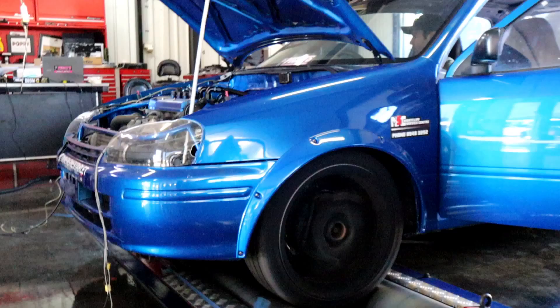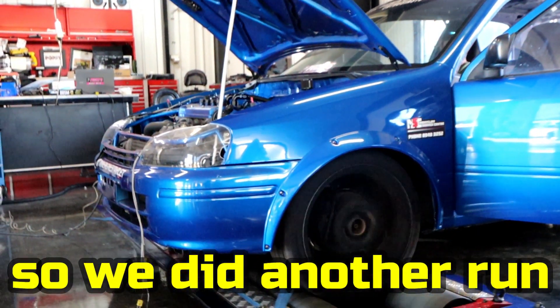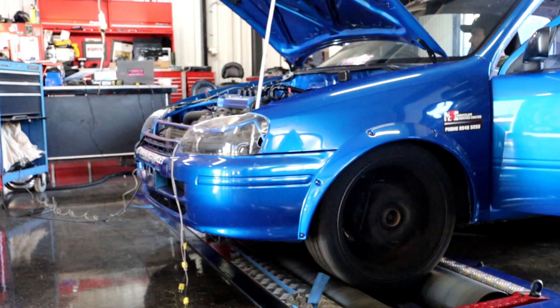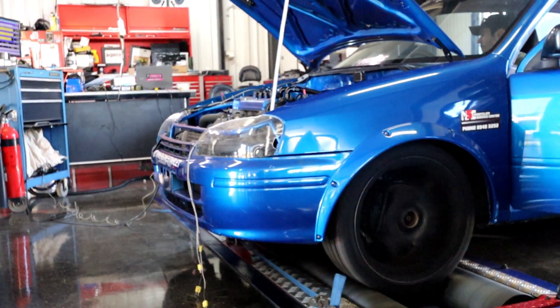The return flow came good. So even after that run we tipped just below 300 horsepower. The fuel flow came good and the fuel pumps feel nice and cool now, and we're getting plenty of voltage — but there's still an air-fuel problem. Even with Keelan adjusting the injectors, we still can't get the air-fuel ratios down as low as we need them, which is around 12 to 12.2.